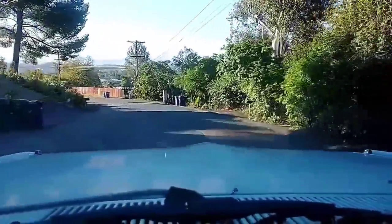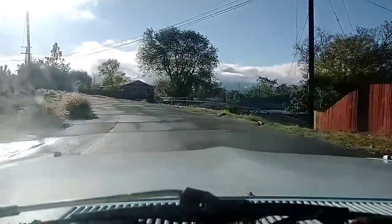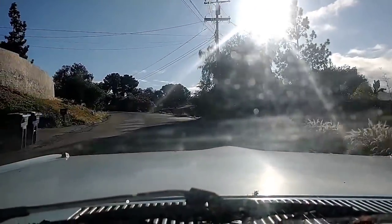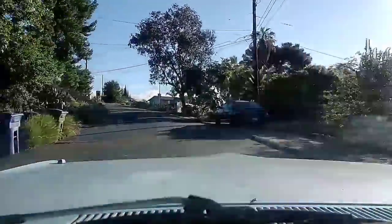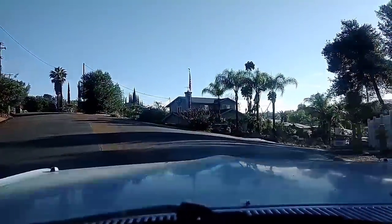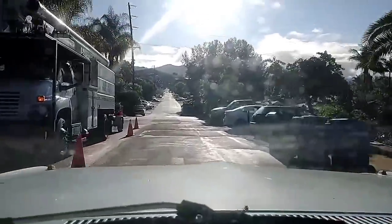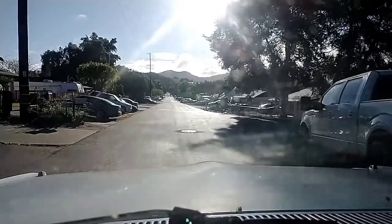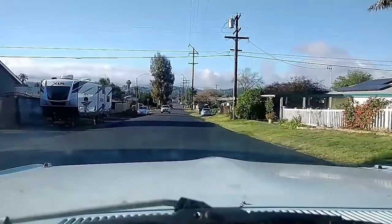So I wonder if it's too much fuel, because it's knocking a lot. It's okay until you get into that power circuit at more than half throttle, and then it really gets aggravated. And there's a delay. It's not like it's instant. You mash on it, the vacuum pulls, and then it starts sputtering. So maybe I need to tweak the vacuum circuit a bit. There is an adjustment for that. The service manual doesn't really want to tell you about it. They just say it's factory adjusted, but...